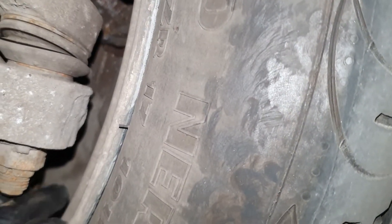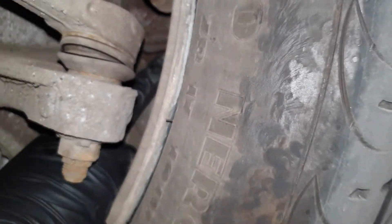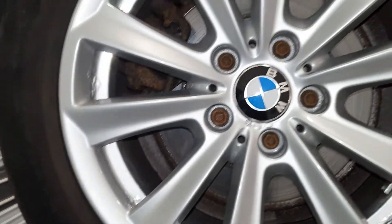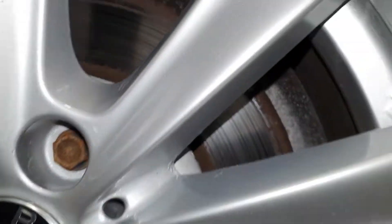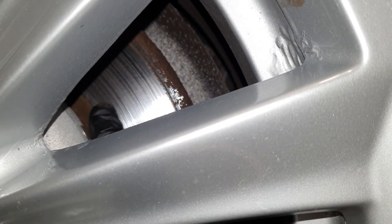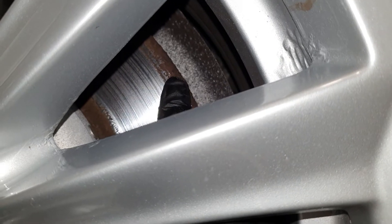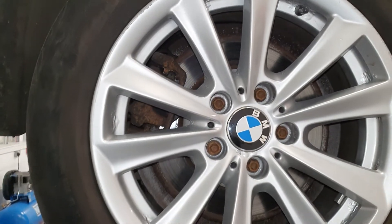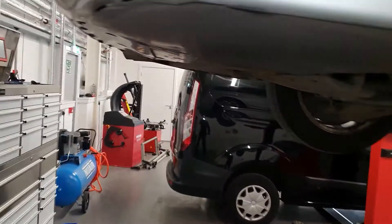We do have some corrosion — it's a bit difficult to see, but if you look through there you'll see some corrosion on the inner face of the rear discs. Tyres on the back are down to 3.3 to 3.5 millimetres. You can see the edge of the disc — there is some braking surface, however the inside face is a wee bit heavily corroded. But you don't feel it in the car, you don't feel it through the brake. No vibrations, everything's driving really well.